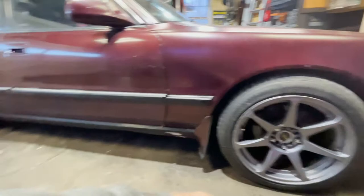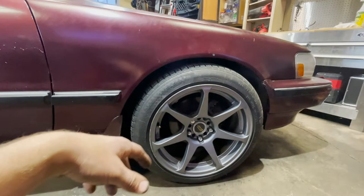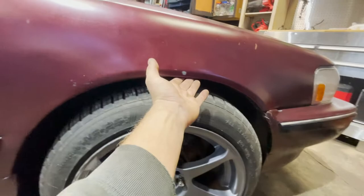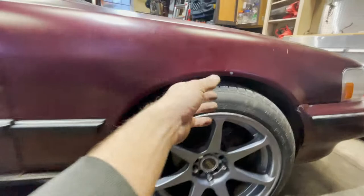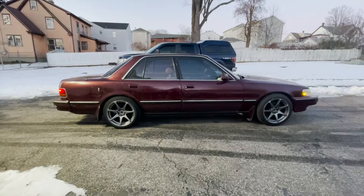Car's on the ground — coilovers are on the rear and on the front. This is with about 3.5 inches on that coilover spacing. I do have a pretty thick tire on here at the moment; I'll definitely be running something a little more stretched. I'm pretty happy with this, but I do have a crappy driveway so I don't want to lower it too much. I'm actually going to have to roll the fenders if I want to lower it anymore, especially with these wheels when I'm drifting. It wasn't too hard of a setup — that's how you put coilovers on your Cressida. Once it settles it should lower a little bit more. Let's see how it looks outside.